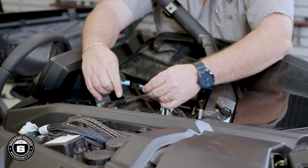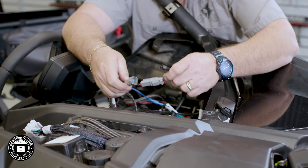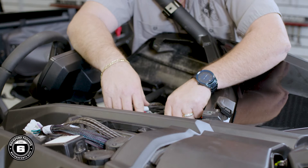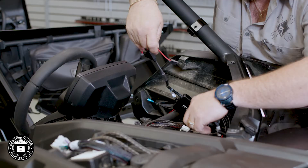Now match your speaker locations to the proper cables and attach. You're ready to install the new Rockford Fosgate Color Optics controller. This is a Bluetooth device that will allow you to remotely access the lighting features through the RF Connect app. Start by connecting the power cable to the PMX harness, and then attach the waterproof connections to your speaker cables. You can utilize any of the eight Color Optics plugs provided.